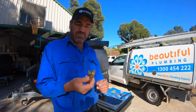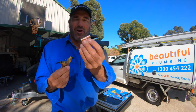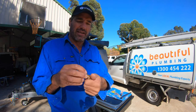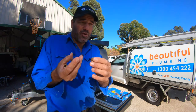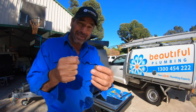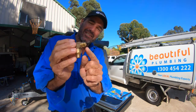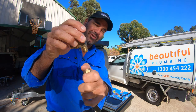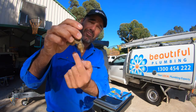The only other option on a caravan or camper trailer is flared fittings, or you weld them — but that's considered a bit old school. I weld them because I can and I think they're far superior. When you flare a joint, you cut the pipe, stick it through the nut, deburr it. I always heat the copper up, which anneals it and makes it soft. Then I flare it — the copper sits at 45 degrees and presses against the brass fitting, and the nut screws on and jams the joint together. That's where the seal happens: copper on brass, tightened up.